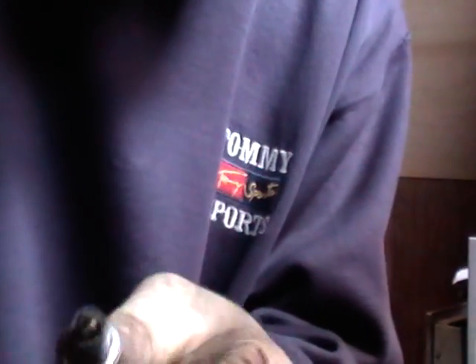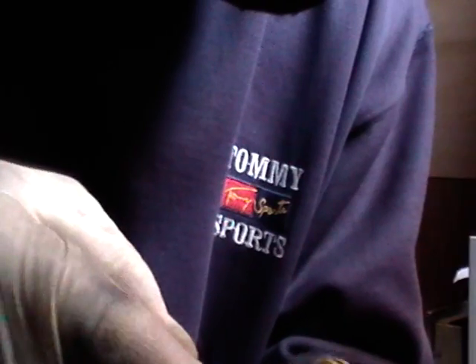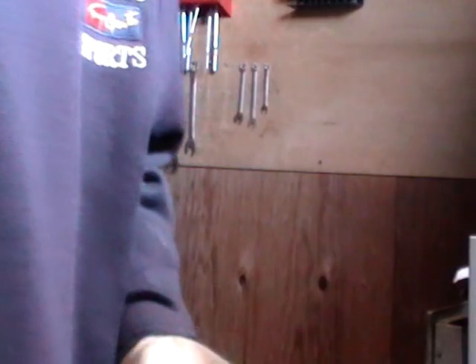What we decided to do is remove and check that the gap on every spark plug on this 1957 Chevrolet is gapped properly. This is the last one I am doing. I have already found four of them that were not gapped correctly. This one is at 30 and they are supposed to be at 35. Now it is gapped properly. Just to make sure we have all the correct specifications performed on this tune up, that is why I went ahead and checked all the spark plugs.